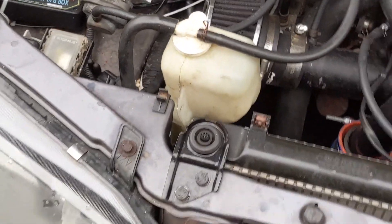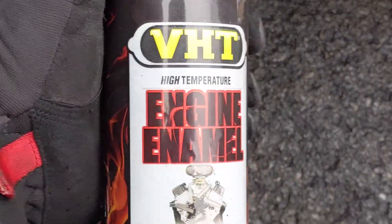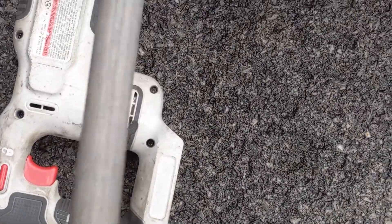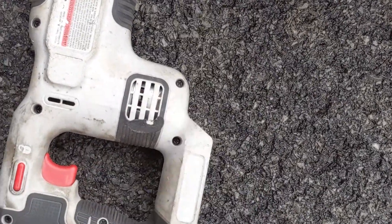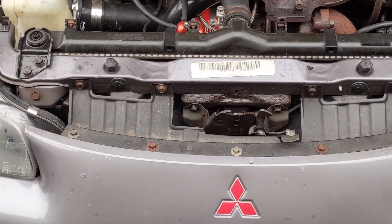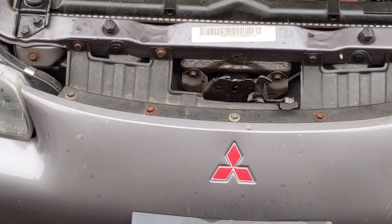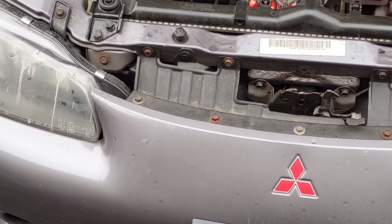I think we might just take it off from this point down, or maybe just leave it all together and drop out the side mount and wrap the pipe around front. I'm not sure yet, but you're definitely going to need yourself a sawzall with some metal blades. I've got some VHT high temp engine enamel in case there's any parts that need to get colored black, and I've got a file to clean up the edges of the pipe that we cut - it's a rounded edge file to clean up the burrs on the inside so we don't end up having aluminum shavings fly through the engine.